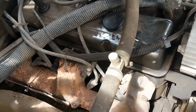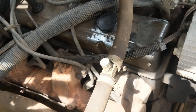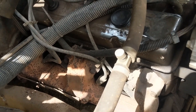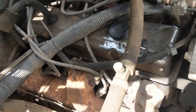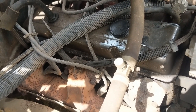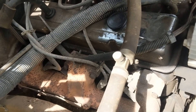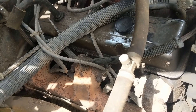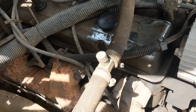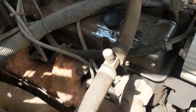This little mixture dial down here is a pro all in itself. If you've ever had to re-jet a carburetor — pulling it off, pulling the bolts, pulling the jets out, putting new jets in, testing it, going back and doing it again and again — that's a real pain, especially if you change elevation like driving up a mountain. This little dial does it all for you in one adjustment. You can just change your mixture right there.